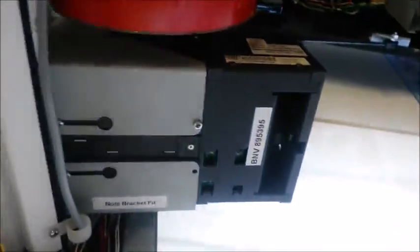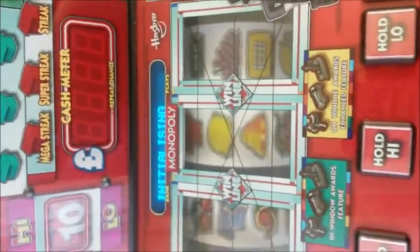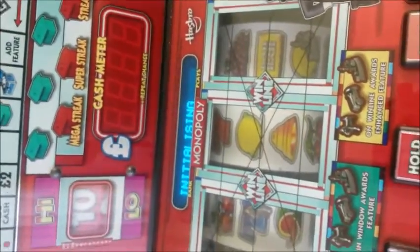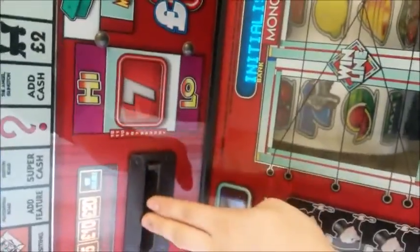Turn your machine back on. Your note reader will now make more noises again. So leave your door open at this time, because now you have to go back and put the BNV code back in. Because what this did is it reset the BNV code inside this unit. It reset the unit identification code. So that was on page 19 of the manual for the JPM Cash.